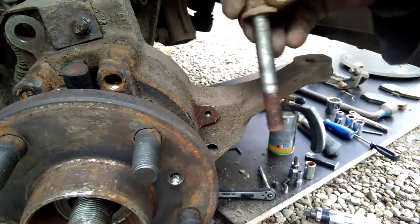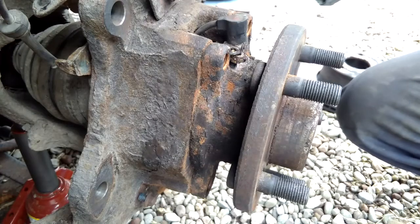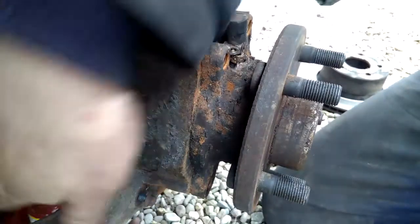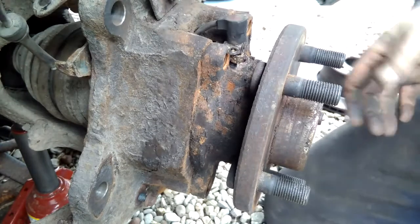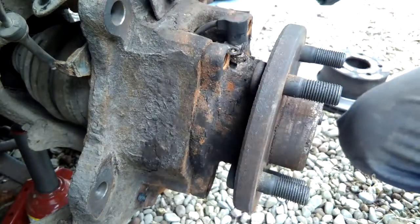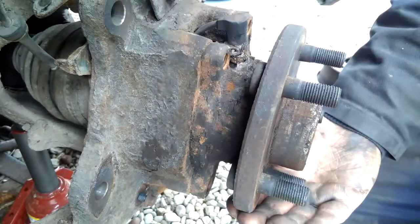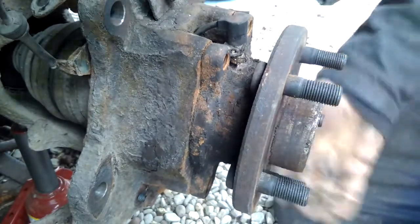So I'll now remove the other two of these bolts. Almost there now. All the bolts are removed. It's necessary to turn the steering this way and that way in order to get some of the bolts out, because parts of the hub carrier are in the way. Now we're at the stage we'll be removing the hub itself, and the drive shaft will be coming out as well, attached to it. So it's quite stiff, so I'm going to give it a tap, or 12. Here we go.